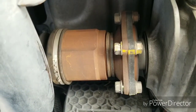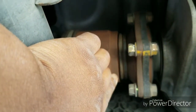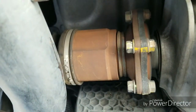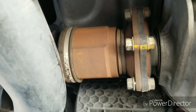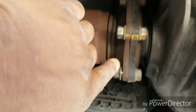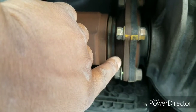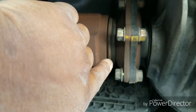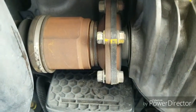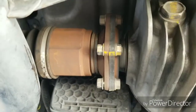And supposedly the half shaft, over time, wears like a pivot on the inside. While it's spinning, it's hitting that pivot, and that's what gives it the vibration, bloom, bloom, bloom. So that pivot is in a certain spot. By spacing it, it moves the half shaft away from that pivot, I guess to a smoother location, and it takes that vibration away. So we're going to see if it helps, and take it from there.